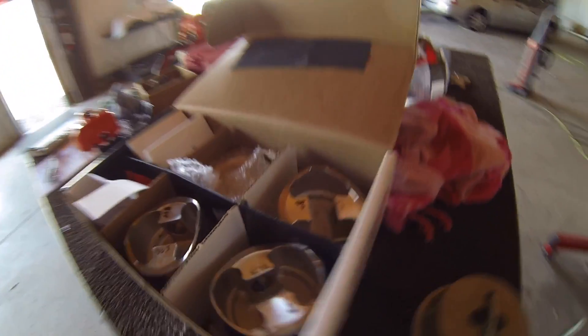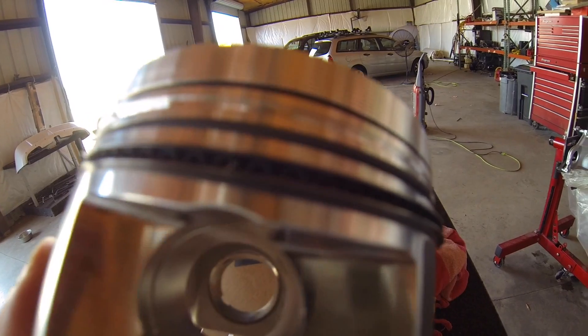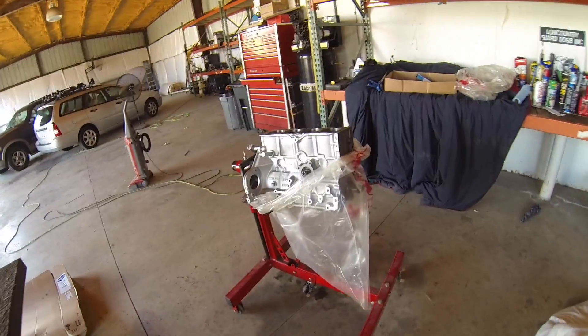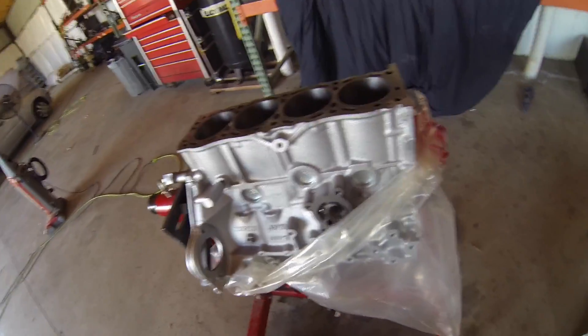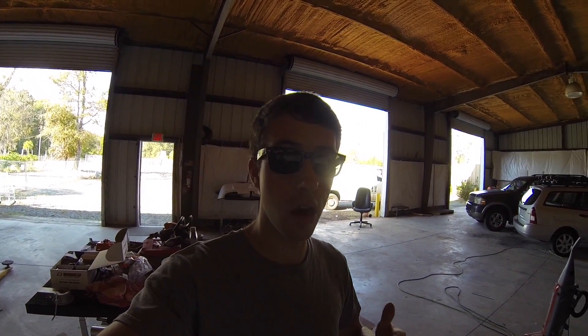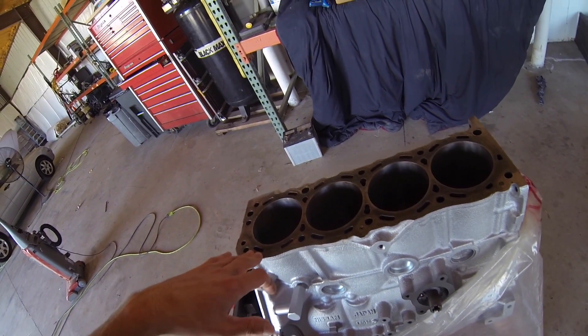You're probably going to see this as one video, but I got the ring filer here and I already went ahead and put the oil rings and the second ring on pistons number one and two. I still have three and four left to do. Tomorrow when I get the ring sets, the only rings I need from them is the number one ring because I messed it up, so I just need to file those down to size.